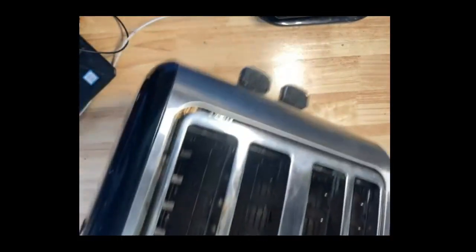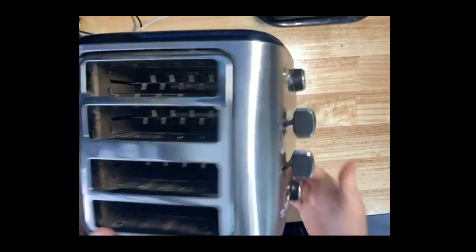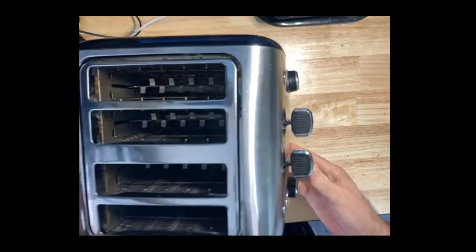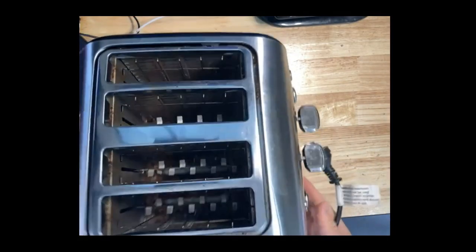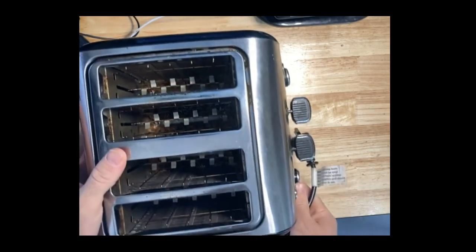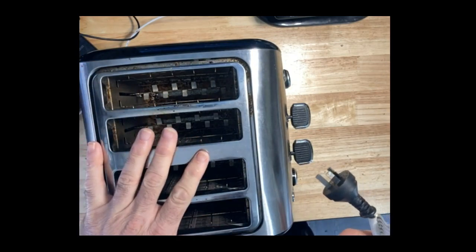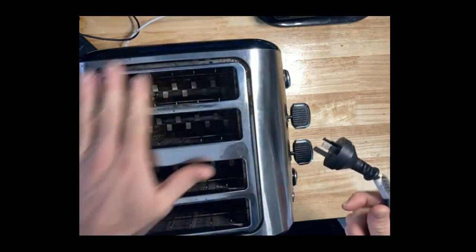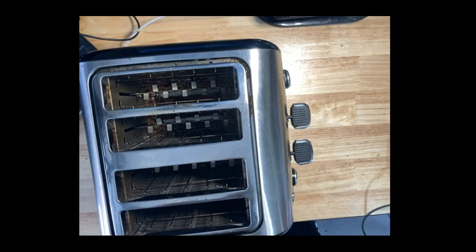I have a toaster — a fairly typical, pretty beaten-up and used toaster — and as you can see there's plenty of metal on the outside of that appliance that should all be earthed. This is definitely not a double insulated appliance. You can look inside and see the elements — there are certainly not two layers of insulation between the live parts and the exposed metal body, so there's no chance it's going to be double insulated. We do need to test the earth continuity for this appliance if we are doing testing and tagging.